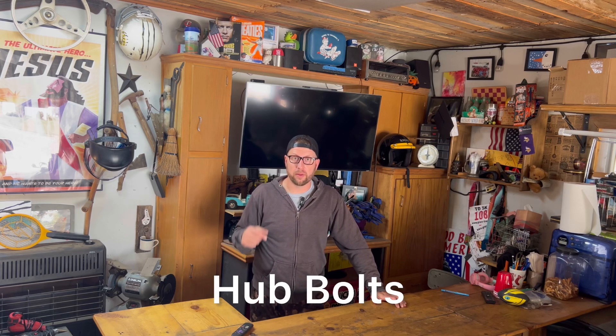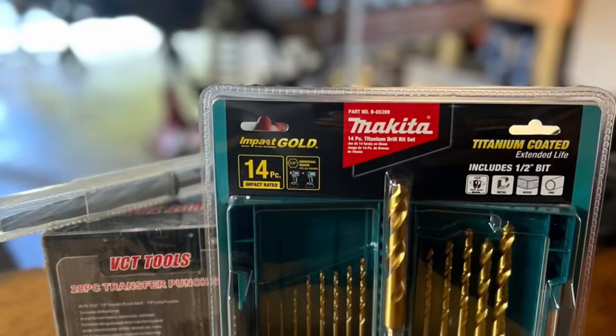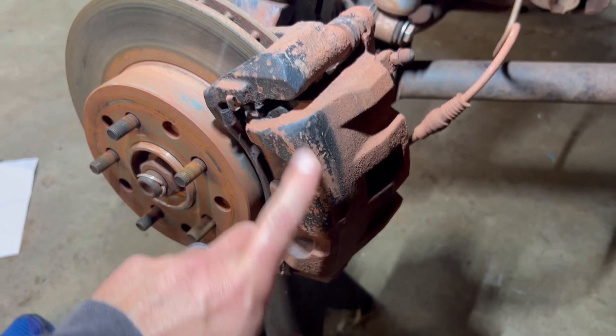We opted for brand new wheel hub bolts at $7.92 each, for a grand total of $47.52. For miscellaneous tools and parts, we bought a 5/8 drill bit to drill out the rotors from a 5-on-5 to 5-on-4.5 bolt pattern, plus some longer bolts to mount the brake caliper bracket. Note: big items missing from this parts list are upgraded gears and upgraded axles — those would add considerably more cost if you wanted a deeper gear ratio and stronger front axles in the ultimate 30 build.